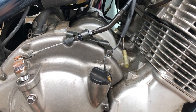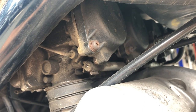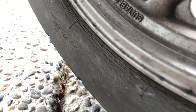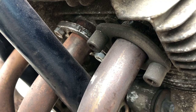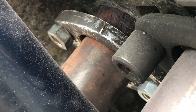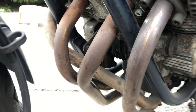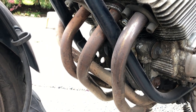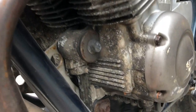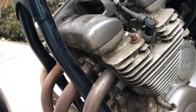The bike does run right now, so it's not essential. The carbs under here need a good clean both outside and inside. Both the tires have some seriously bad dry rot, so those need replacing. The exhaust pipes have some mismatched hardware, and hoping to remedy that with some OEM parts. Also going to clean up the headers and make this thing look shiny new, because those headers would look sick if they weren't covered in rust and corrosion. Also going to clean up the front of the bike to make it look like it hasn't been sitting outside for a long time.